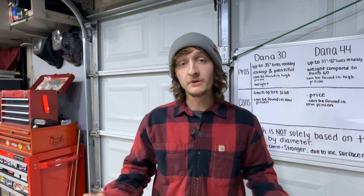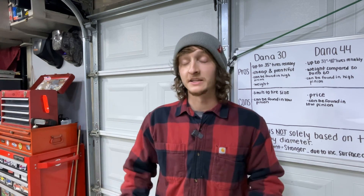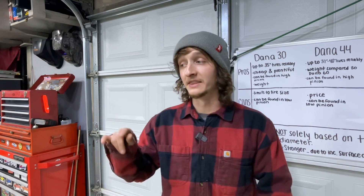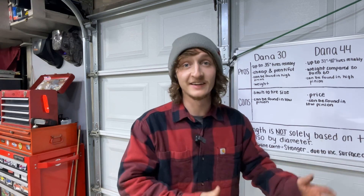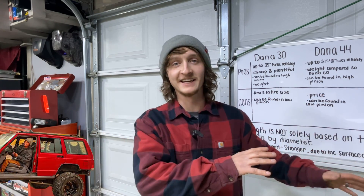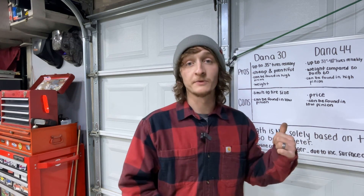I got them from a friend who bought them for $200 for just the rotors, calipers, and hubs. When he was done he offered them to me before listing them for sale and I couldn't pass up a set of one-tons for $200. They sat in my garage through several moves, all the way from Massachusetts to Colorado over two and a half years. We finally decided this is the direction for the Green Cherokee. We're going to re-gear them to 5.38s, run ARB air lockers front and rear, and go with 40-inch Pro Comp tires — the same tires we're running now.